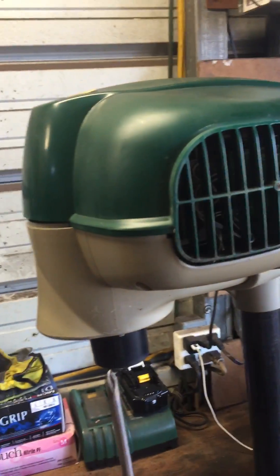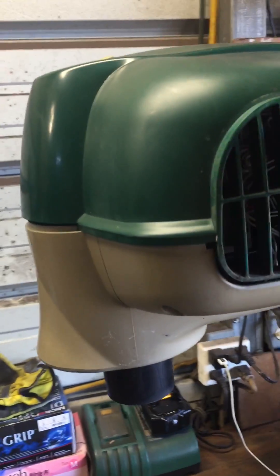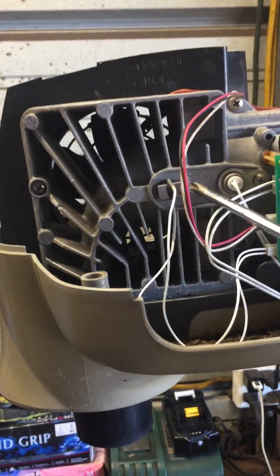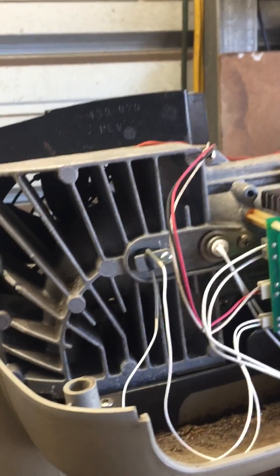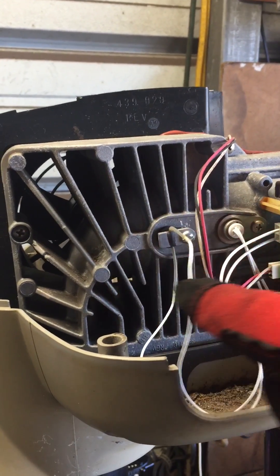So let's get into this. There are four screws, one in each corner underneath, and you simply take those screws off and lift this lid off — and you expose the inside. Right inside here you're going to see that thermistor. This right here is the manifold, and that's essentially where the thermistor is located — it's going to be somewhere attached to the manifold.